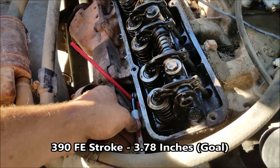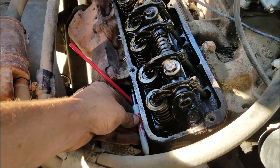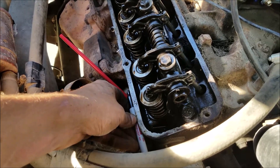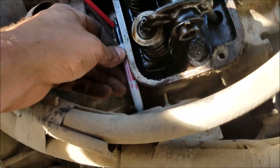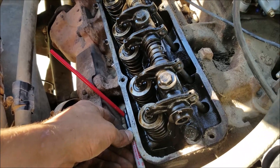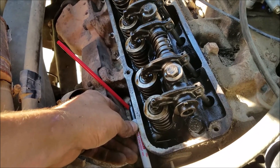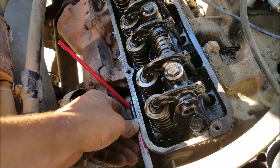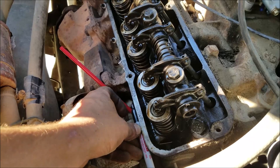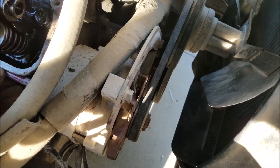What I like to do with my permanent marker to keep it nice and consistent: I go against this exhaust port here and push it all the way up to the cylinder head so it's down and against the cylinder head, then I set it against the alternator. This way we have three points of contact so we can be very consistent with our marking. There's not a huge difference between a 360 and a 390 stroke, so if you get a little wonky with your permanent marker you might get a false reading. I'm going to go ahead and make the mark on my straw.